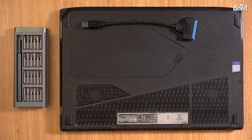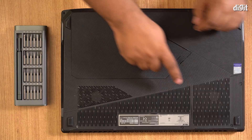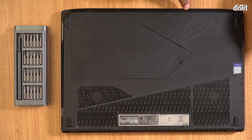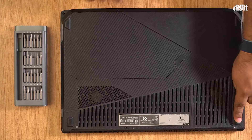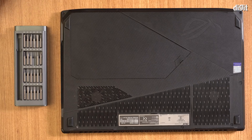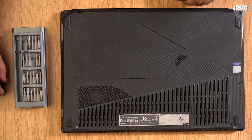Please see your laptop's user manual for specific instructions, as our demonstration today could be different from your actual device. Locate all the screws on the bottom and find an appropriately sized screwdriver to take the bottom panel off. Sometimes there may be additional screws under the rubber feet of the laptop, so do ensure that you've removed those too.